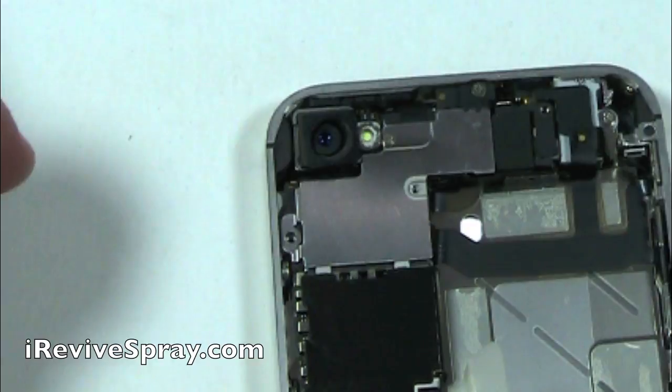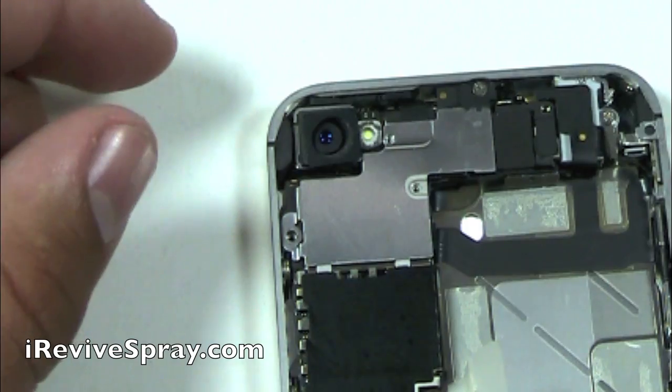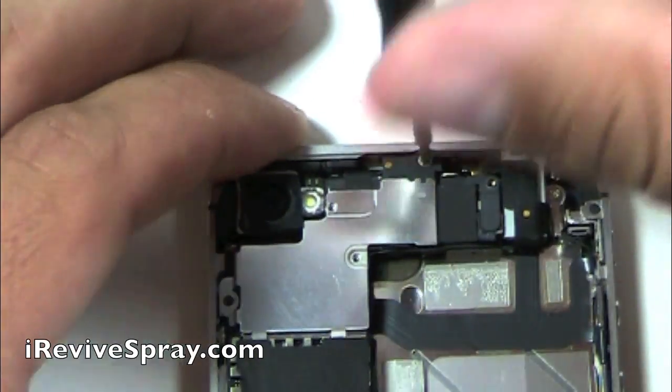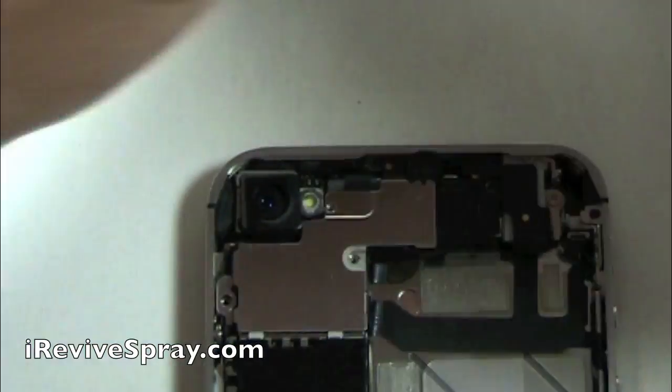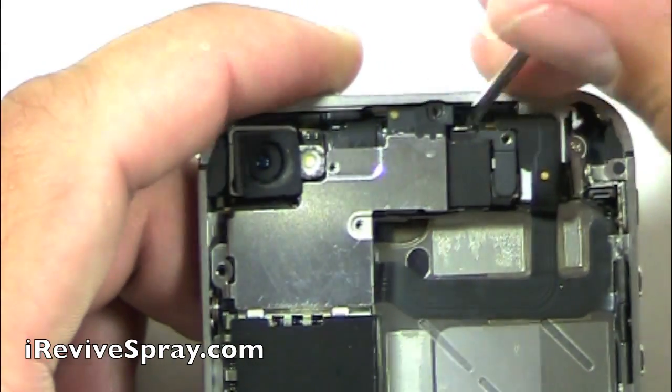Going around the top flex cable cover, there are 5 screws that you need to remove, all Phillips. Make sure to keep them in order, they are all different. So whenever you're setting them out, I think we're going to have a screw chart up. There will be a link in the description once that's available.